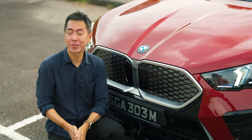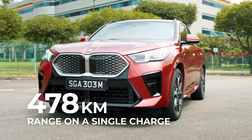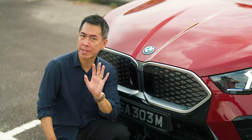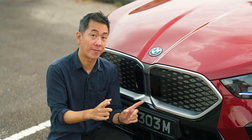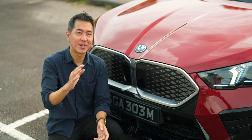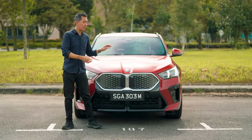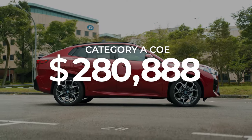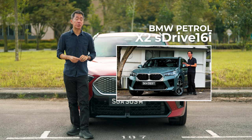Because this is electric, let's talk about range. The iX2 can apparently cover 478 kilometers on a single charge, which is impressive because the battery isn't huge — it's 64.8 kWh — but it uses NMC chemistry, so it's the kind you don't want to charge to 100% too often. The electric motor drives the front wheels and has been detuned to 110 kW for Singapore, about 150 horsepower, which makes this car fairly slow — 0 to 100 takes 10.5 seconds. The upside is you can buy the iX2 under the more affordable Category A COE, bringing the price to $280,888, exactly $20,000 more than the petrol X2 sDrive16i.